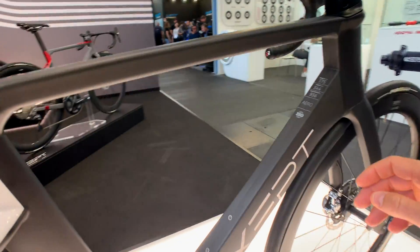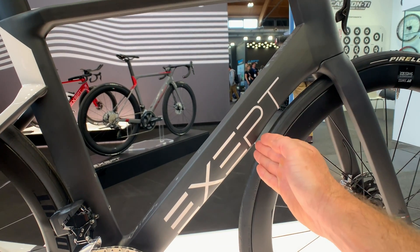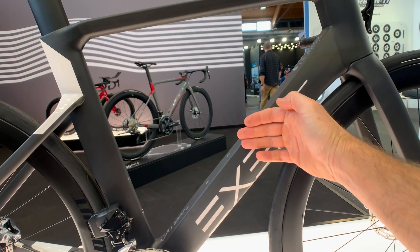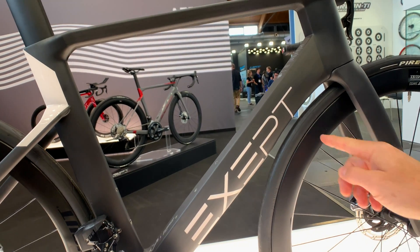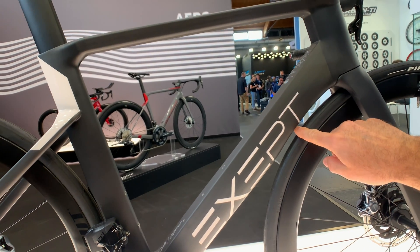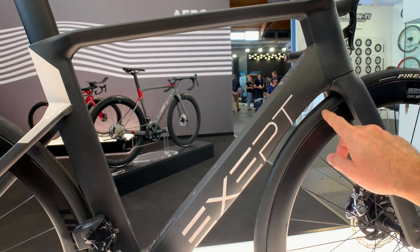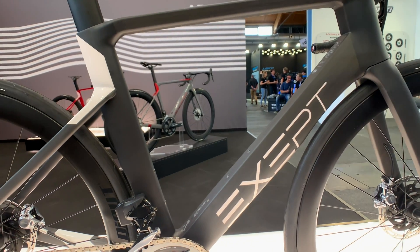Going back to the front — the gap here. A lot of people want to push that tire as close as possible to create a kind of laminar airflow over it. But what happens is in a crosswind you end up with a wall if that's closed in too tight. What they found is that when testing in a crosswind, it created less drag because the air could flow through that gap a little bit and just keep on going.